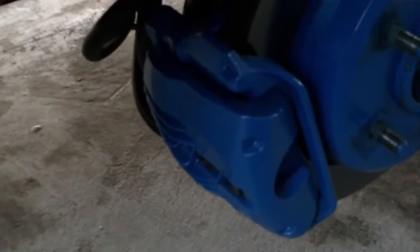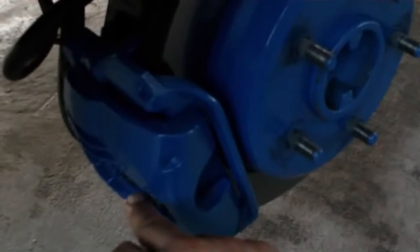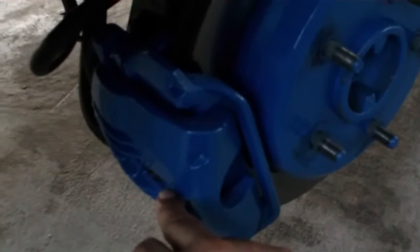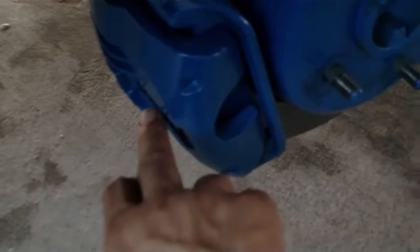Let me explain what's going on. It was brought to my attention that these right here — when I did these back brake calipers — I took a picture of it. I've here recently started taking pictures again so I can post on certain forums. Just by looking at the pictures, a couple guys on the forum told me that those two pins sticking out of your caliper aren't supposed to be there — they're supposed to be inside. It's going to require me to take this caliper off so I can get these pins in the right way. I tried to get them in without taking the caliper off and it just ain't happening, so I have to take it off.